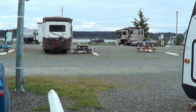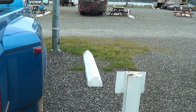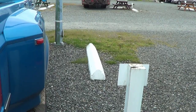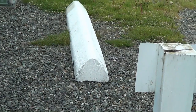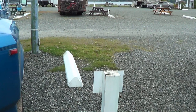Next tip is a simple one: don't hit stuff — like these curbs here. I see some people cut their trailer a little sharp and hit a curb. In the truck that might not feel like much, just a little tug, but you could do internal damage to the tire. Especially if you hit a sharp edge, you could damage one of the internal belts. It might not fail at the time you hit the curb, but 50 or 100 miles down the road that belt separates inside and you end up with a bad blowout. I've really concentrated on making sure when I'm turning a corner I'm not going to run over anything.